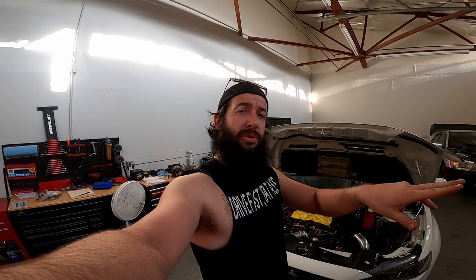All right boys and girls, we did get something in — some new stuff today. I opted for a different hard wire for the double pumper setup. I wasn't quite comfortable with the way I had it set up — it gets hot, the pump gets hot, I don't want to deal with it. Luckily EvoSpec Performance, the place where I got the double pumper setup from, offers that. I had to send the double pumper unit back to Daniel so he could do the separate hard wire for the main pump. Now the main pump and the second pump are both going to be hard wired, controlled by the ECU. When I hit a certain PSI, my tuner will be able to set up when the second fuel pump comes on. Both will have their own relays, their own power source and grounds.